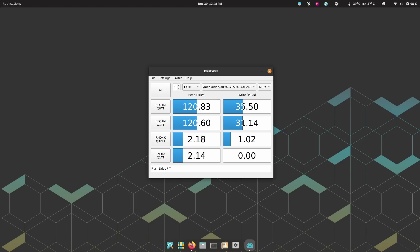I also tested this with USB 3, since that's what it supports as well. I stuck in a 128 gigabyte Samsung USB 3 thumb drive and tested the speed — I was getting about 120 megabytes per second on the read. I did a second test later and got 133, but the screenshot shows 120. That's pretty impressive for a USB 3 thumb drive.